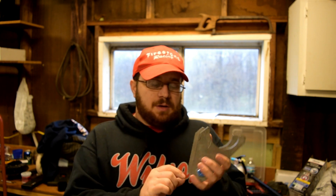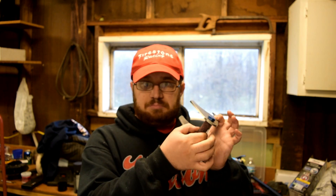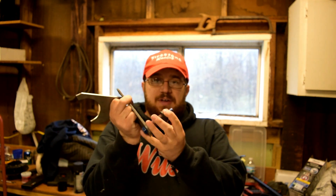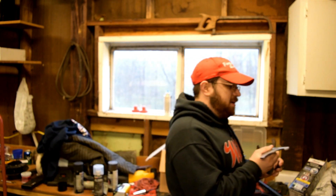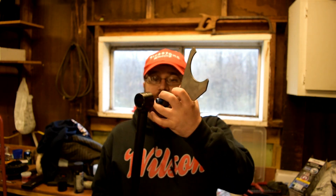So I thought I'd take some rubber from a hose and put it around the bolt to make it thicker on the inside — that way you can just use a normal bolt, don't have to drill it out. Fills the gap. Super easy. Well, I put the bushing that goes into the bar over this rubber hose, and with a little cursing it'll fit. However, whenever we go to put that inside the actual traction bar, it had to stretch out too wide and was not able to fit in properly. So this was too thick.